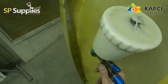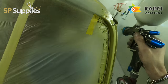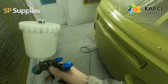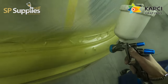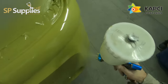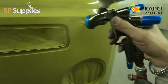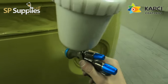So this is the end of coat number one. We put three coats on this in total, so the first coat has gone down - just a light wet coat, it's just basically something there for the consecutive coats to grip to and just put that initial layer of colour on and try and make sure we can get full coverage in all the areas. So if, God forbid, we did miss a tiny little bit on the next coat or on the final coat going under on the rails or on the roof, then we know it's already 100% fully covered. Now I'm just going to tweak my gun settings in on this first bit just so that I know I'm getting the right amount down without the risk of it running, and we ended up just running it full fluid in the end.